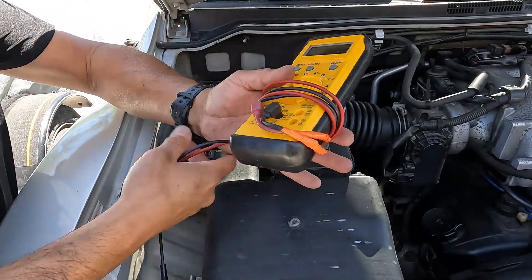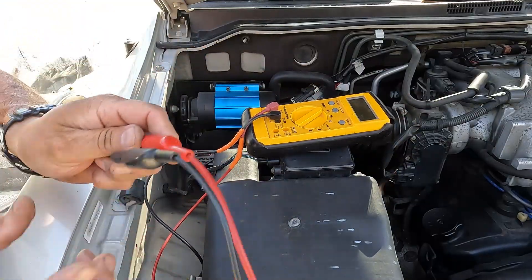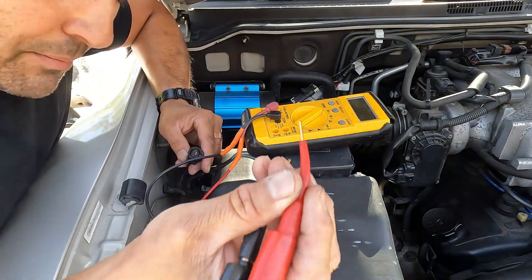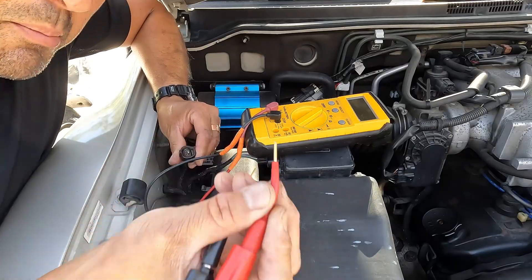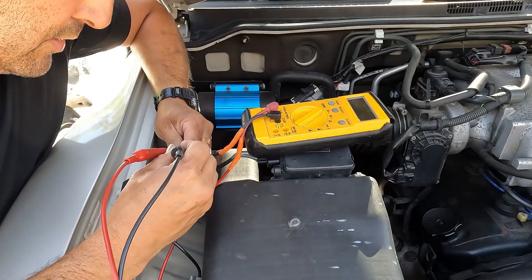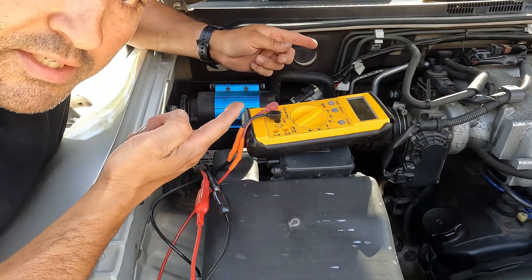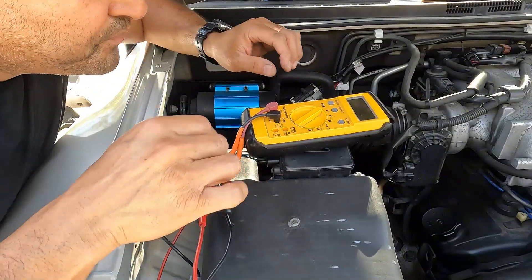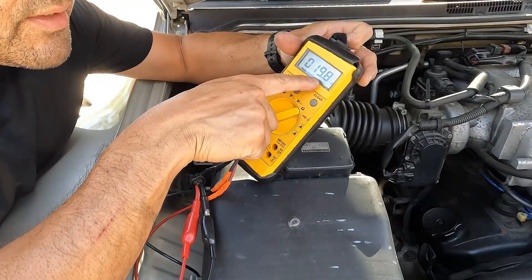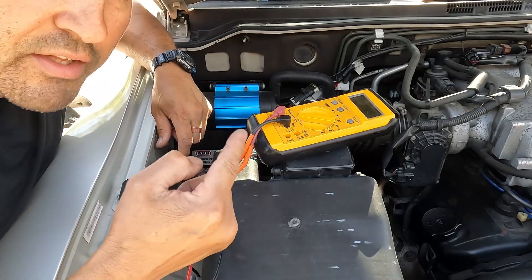All right, let's hook up this meter. I got these terminals here — I'm inserting them in the back of the connector and they fit pretty well. The key is off, obviously, because when you check ohms you don't want any power on the circuit. Put the ohm meter on, and we have 19.8 — 19.7 ohms. So right now from this connector we're checking the EVAP vent solenoid.